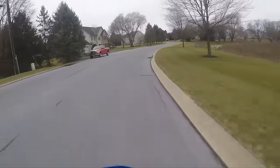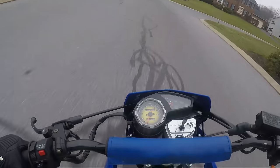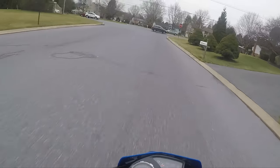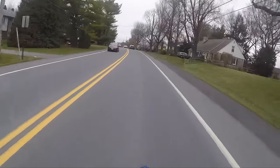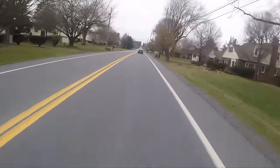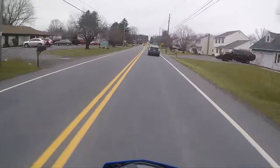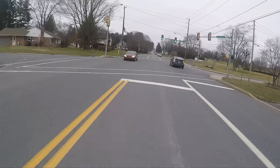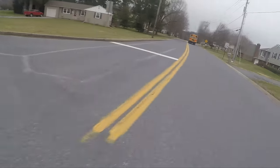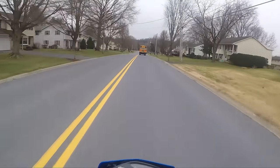Could this thing be reliable transportation? From what we're seeing, with people commenting that they have this bike, it actually seems like it's kind of reliable — which kind of blows my mind. Another thing we heard from some people is that you can modify them. From stock, this is not producing the most amount of power. So a nice jet kit, get the carbs re-jetted, maybe a new intake, maybe a more obnoxious exhaust — you might be able to squeeze another four or five horsepower out of this bike. But you can see I'm not having any problem keeping up with town traffic.